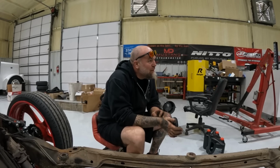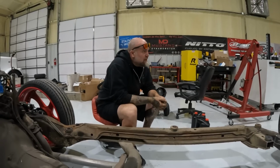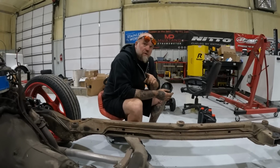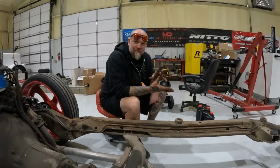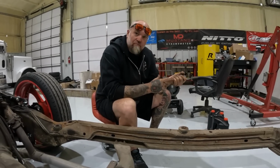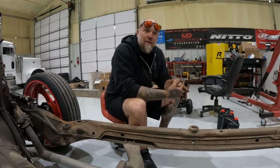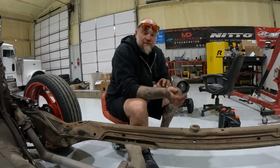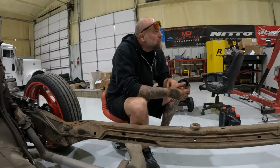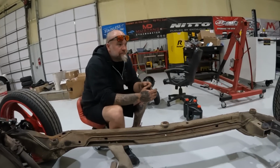But I think the biggest thing to making the clamshell work is the motors on them things. And as long as we can grease those cables up and stuff, I don't know if they make the cables anymore, but they make the motors. They look just like a K5 rear window motor to me. I took my drill and it would roll the window and the doors and everything. When we first got this thing, it all worked. It's just slow. So I believe if we grease it, clean the tracks up, do all that stuff, that stuff has to come apart anyways. There's nobody that makes repops for the rubbers. That's crazy. I guess, why would you?